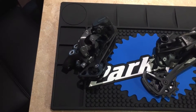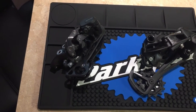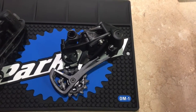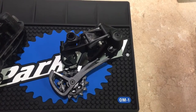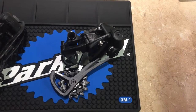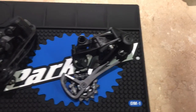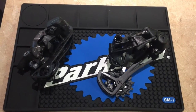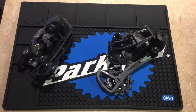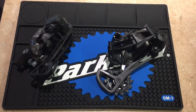One of the reasons — and this is super relevant — is the stiffness of the design. You want a stiff derailleur because a stiff derailleur doesn't flex under torque and it indexes better. The XT is by no means a soft derailleur — it's a very high-end mech — but even in the shorter design you can flex it. Eagle by contrast is so stiff that when you first take it out of the box you think something is wrong with it or that it's seized. But it's really just very firm. Even once you break the grease in it always resists being flexed. Every time I've seen Eagle in operation on a bike it's just bam, bam, bam — dead straight, super stiff. The indexing is quite impressive.